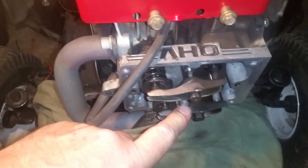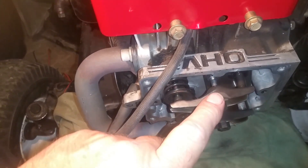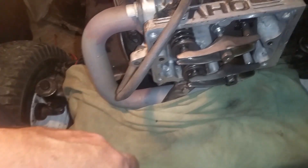We just checked it. It's supposed to be four on the intake and that is about 15 right now. We're supposed to be six on the exhaust and that's at 30. So we're going to adjust them.